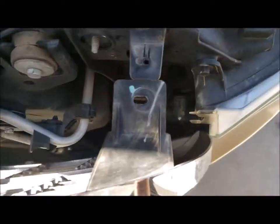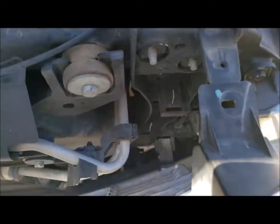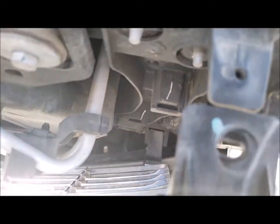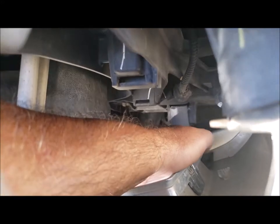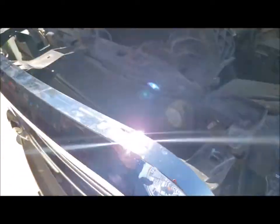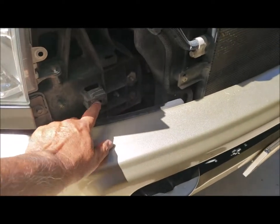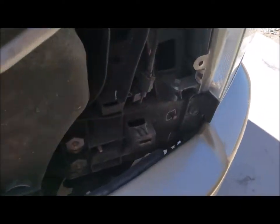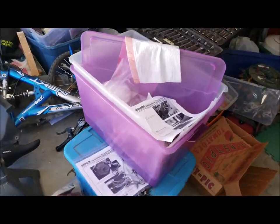The next thing we're going to do is take off the grill. Once you get those four bolts out, it's pretty much loose, but it's held on by these clips. You can see one of them right down there. And to get this off, the best way to do it is stick your hand down there and then just start pushing out and it'll just pop out. Once it pops out, you just open it like a door. That's the best way to do it anyway. And there you have it — no busted clips, everything looks fine. What these are hanging on to is right here, so you've got to kind of get your hand in. I did it from this side; you can do it from either one. Got my hand right in here and just started pushing and it just popped right out.